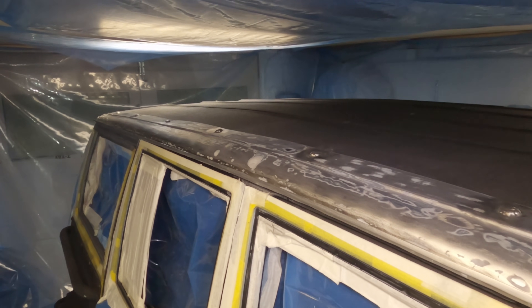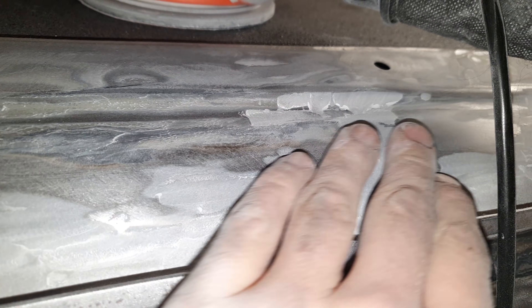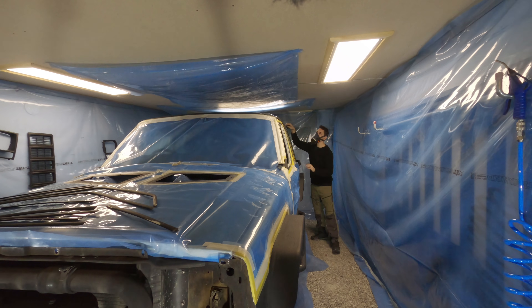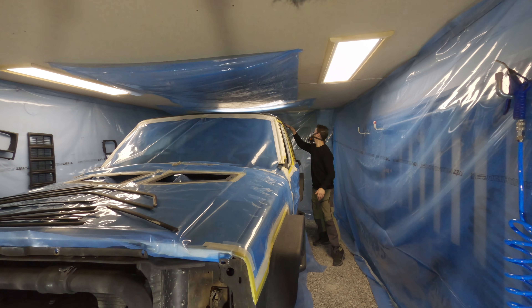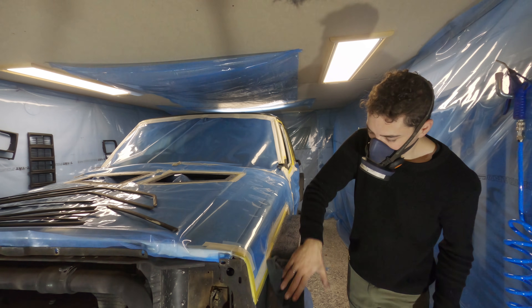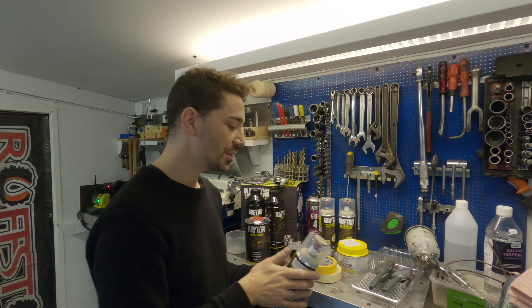But the biggest job is the roof. I welded in those new drip rails — you can see them there, looking nice, ready to paint, have been for months. But that's bare metal, and I'm relying on a mechanical key. So I've scuffed those down — started with 80 grit on the orbital sander, then went to 180, then 240 to get a decent mechanical key. I've wiped down the whole vehicle with panel wipe, a degreaser. The most important thing is having multiple rags — don't just use one towel for the whole car. Go through loads of them until you can run over the whole car with a clean towel and it barely changes colour.